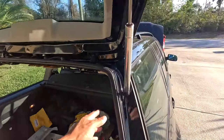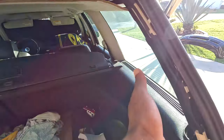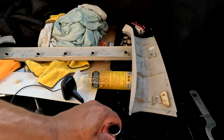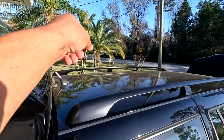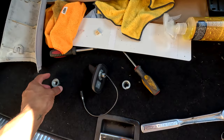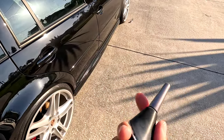To remove the antenna - on a wagon you have your top piece across there and side panels on each side. Pull all three off, then carefully pull the headliner down and you can get in there. It takes a 22mm socket for the nut that holds the base on the bottom. Carefully get in there, unplug your antenna, then simply slide it out. Reverse the process for the new one. Snug the bolt down - not super tight, you don't want to crinkle your roof. With the antenna unplugged, fish it through. You can see the bottom seal is gone and all faded.